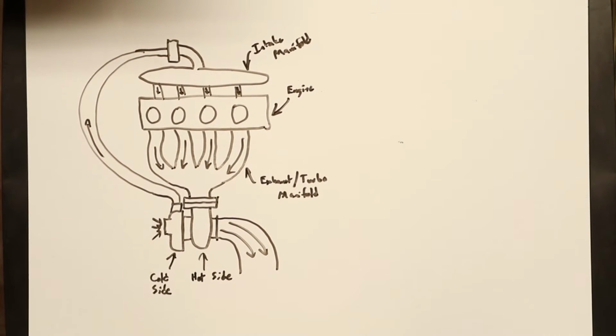The big issue with making as much boost as possible all the time is with more modern turbochargers and modern engines, you can make too much boost and in turn make too much power with the motor. You start breaking rods, pistons, cranks, cylinder walls, all that kind of thing. There's only so much heat and so much power the engine can handle. And the turbochargers are capable of pretty much producing as much boost as you want. I mean, in my case, I can produce more boost than I will ever need to run through this engine. There are cases out there where no, a turbocharger will not do it. We'll get into all the turbo sizing stuff maybe in another vlog episode.